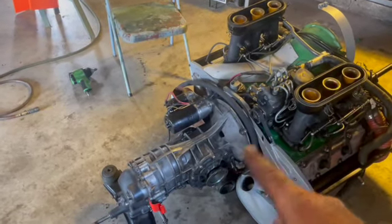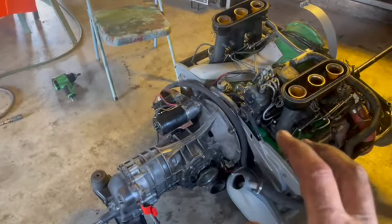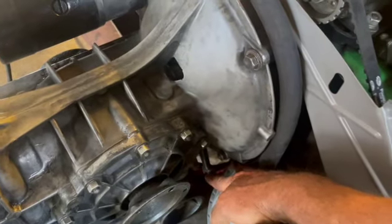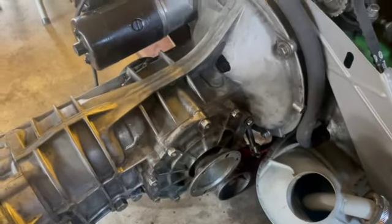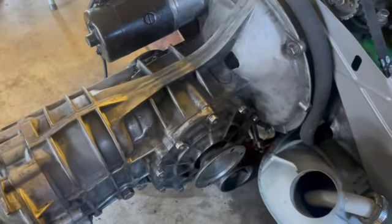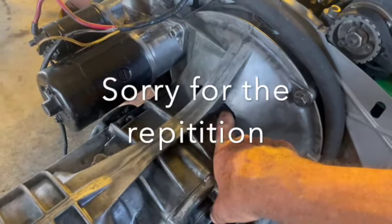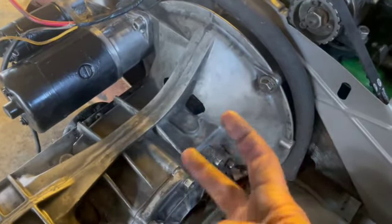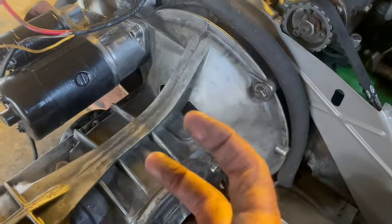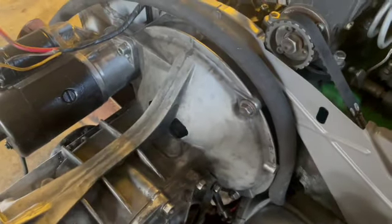But remember, after you install, you've got to take your throwout bearing and lock it in. So your clutch fork down here, again, it's going to pull. It actually works in this direction. I know it doesn't look like it will, but that's just the way it's configured on the 70, 71, same thing. I had a 71. It was the same screwed up system. They only did this in 70 and 71. So they give you these little windows so you can view down in here and manipulate and rotate the tangs on the throwout bearing, so the clutch fork gets behind them and then you're locked in. She's ready to be pulled on to disengage and engage. Disengage, engage. Yeah, so we're ready to go back in.